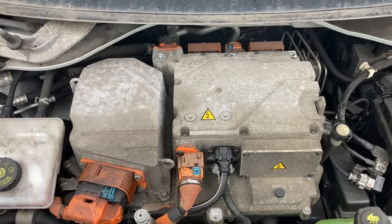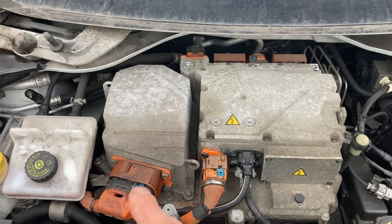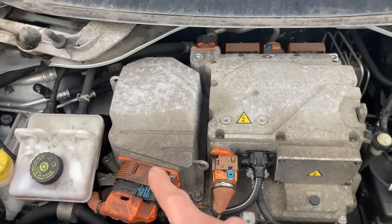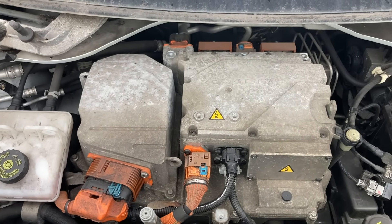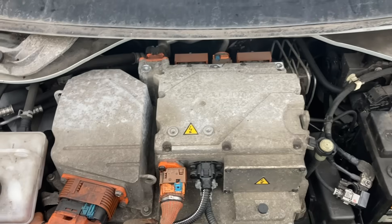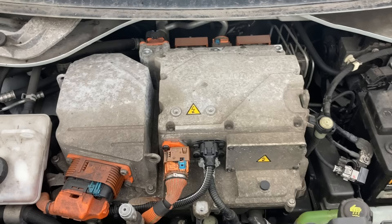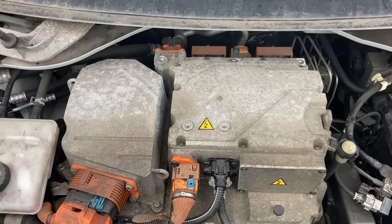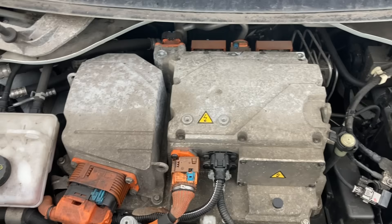The BCB means something in French and it's effectively a high voltage junction box charger. This connector is the incoming AC — you've got your Type 2 charging socket here and the power literally goes straight there as AC. That's the charging filter — it's checking your voltages and earth resistance, stuff like that. Then it goes into this box where it actually gets rectified. The Zoe is a bit weird in that it uses the motor windings for boost conversion, kind of like an inductor, but the bulk of the charging is done within this box.